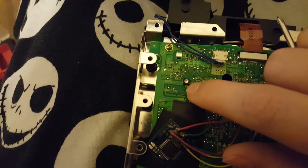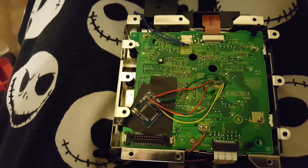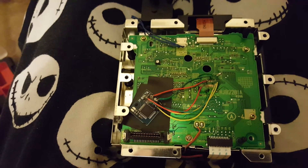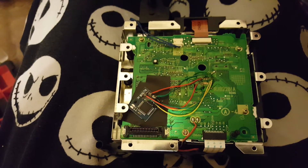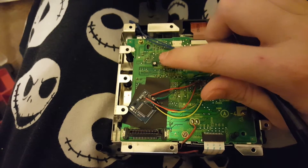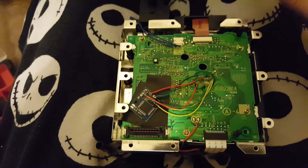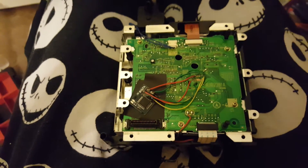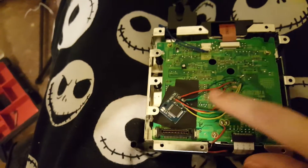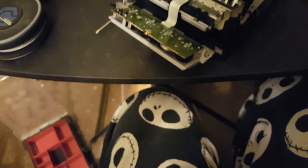This thing here is the potentiometer, which is a fancy word for an adjustable resistor. Basically what it does is it tones down the laser — they have a laser to read the discs, and this controls that. The higher the number, the higher the resistance, so the laser is weaker. A 500 ohm reading means more resistance to the laser than 100 ohms. You want to install this and then put your laser assembly back on.